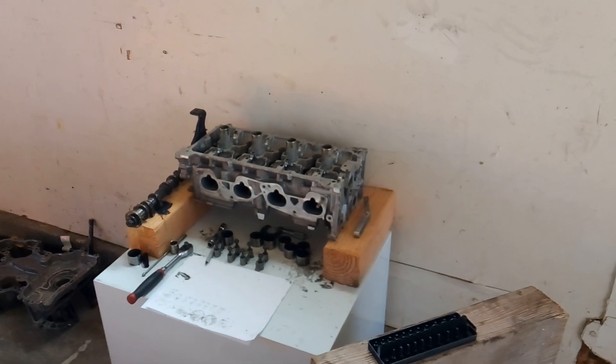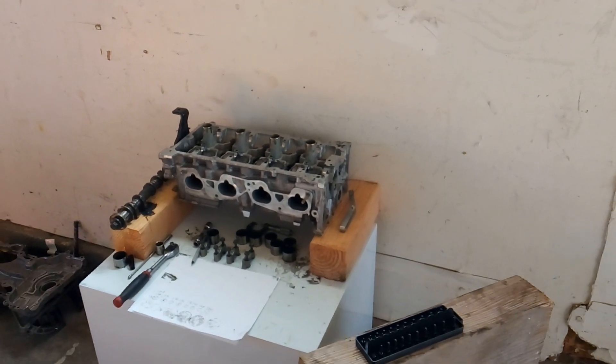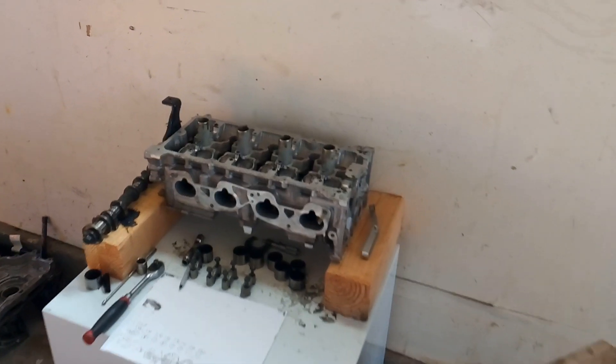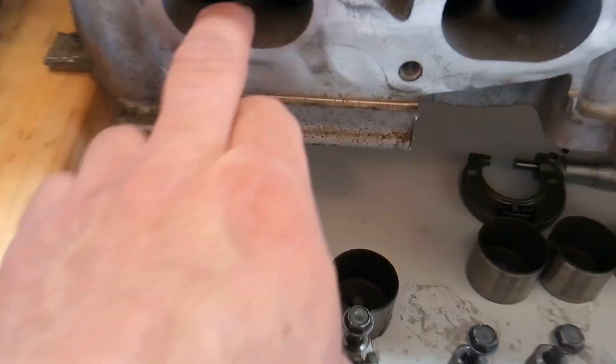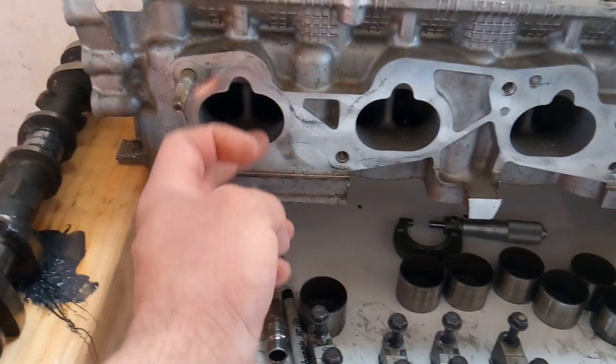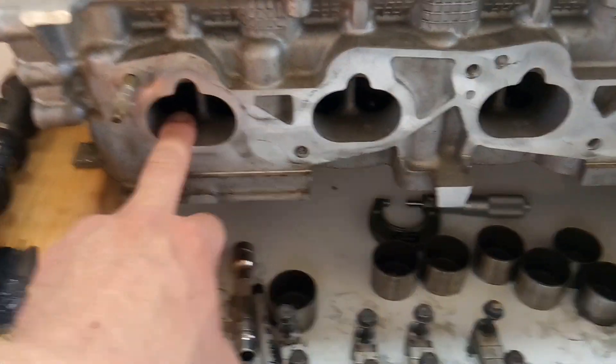The human eye is not going to be able to see the valves open — it's literally that fine. So what I did was introduce just a little bit of water to sit on top of the valves, and within a matter of minutes I had water seeping through the valves, which confirmed that the valves were open.